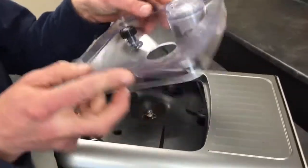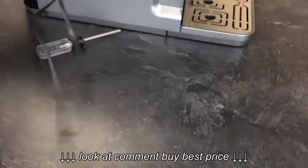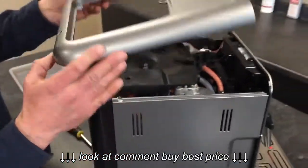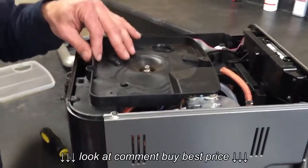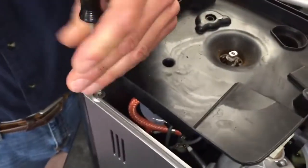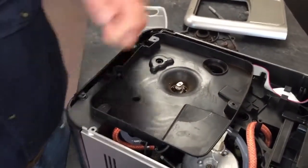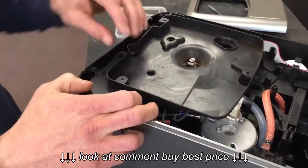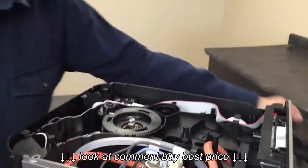Pull this off, and this gasket here comes off with it — we'll worry about that later when we put it back together. Now the top will come off; lift the back and it just slides right off. That's easy — this is actually a very easy machine to get in; the service guys like this machine a lot. Then we have two screws to take out here, again T10s — these are the black ones. Set them off to the side; the case will come apart very easily and this whole top comes right off.